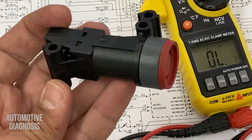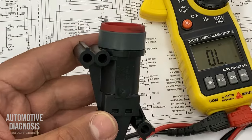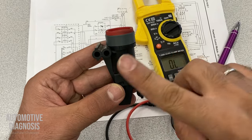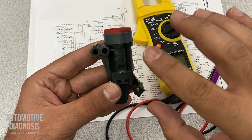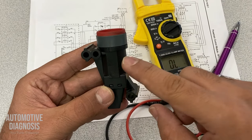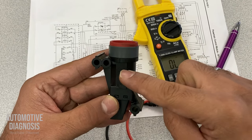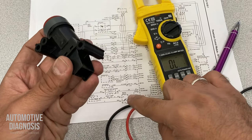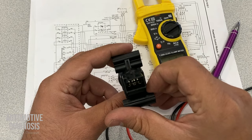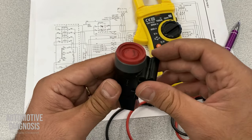So what happens normally for the inertia switch, because when we say inertia switch, if you do any hard braking or in case of accident, this inertia switch is responsible to cut the power. So sometimes even if you haven't had any accident, on some hard braking, there is a switch in there, this switch is gonna jump up and it will open the circuit, so you won't have continuity anymore between those two pins. Obviously your fuel pump is not gonna get any battery positive as well and is not gonna run. So how can we fix it?